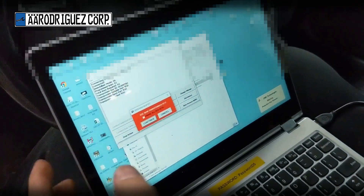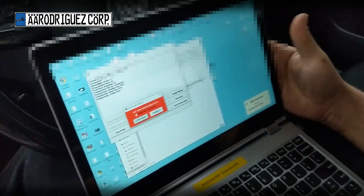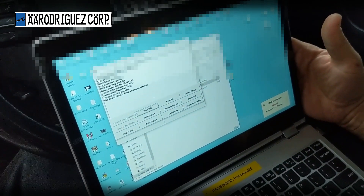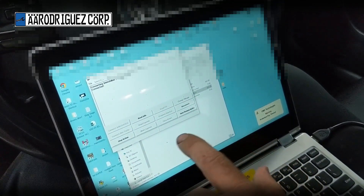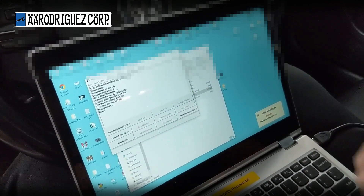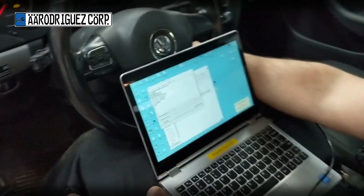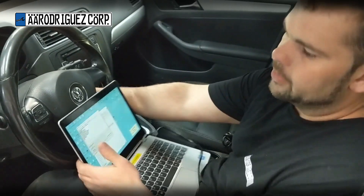Right now I'm going to pull the key from the car, put in a new key, press Continue, and press Program New Key again, then Continue. It's done — the immobilizer programming portion is complete. The car will start with no issues and no flashing lights on the dash.